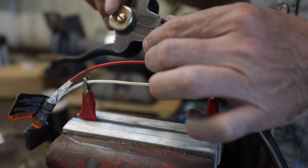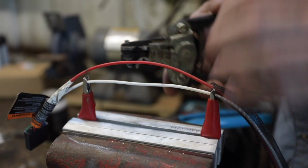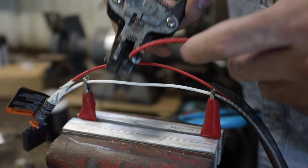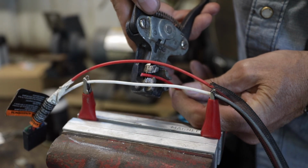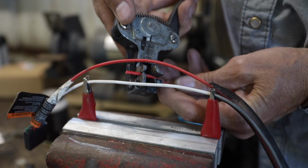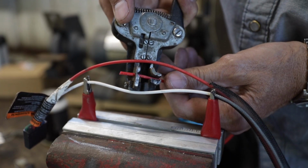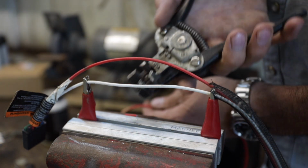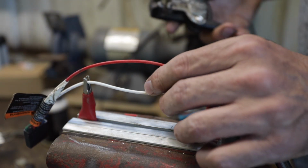that's really helpful is a wire stripper. I think this is a Snap-on or a Blue Point, and how it works here. These used to be really expensive back in the day, but now they're pretty affordable. But they're really clever. You can see it's sized for your particular size of wire, so you find that, and then you just pull that off. You put that in there, and as you push the handle, it locks and bites that piece right there and strips off the end. If you're doing any amount of harness work, you can buy something equivalent to this in the $30 range. So it's really handy for this.